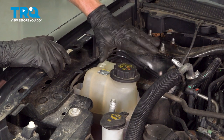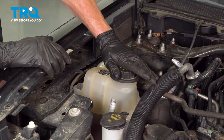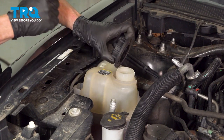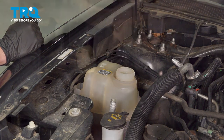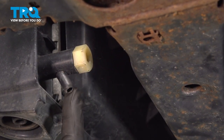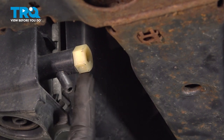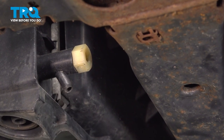Make your way up along the top of the coolant reservoir. We're going to feel it and make sure it's cool to the touch. Turn it counterclockwise and remove the cover, lifting it up and away from your face in case there is any pressure. Give this a quick inspection and set it aside. Now we can make our way underneath the driver's side of the radiator to start draining. Make sure you're wearing hand and eye protection at all times. Use a 19mm and turn counterclockwise just enough to let the coolant drain into a collection bucket.